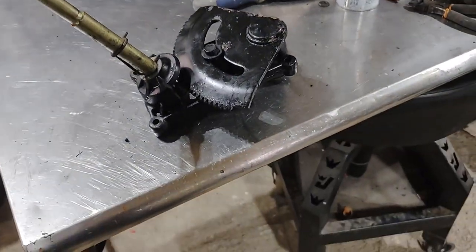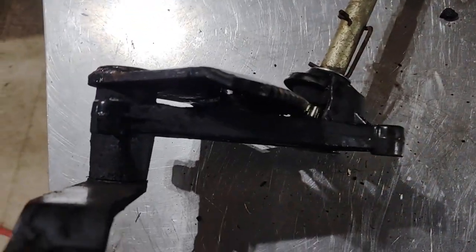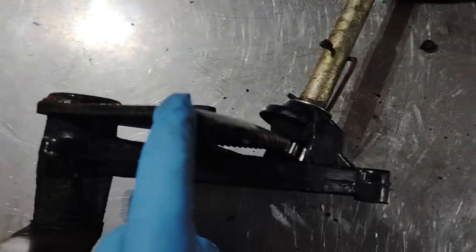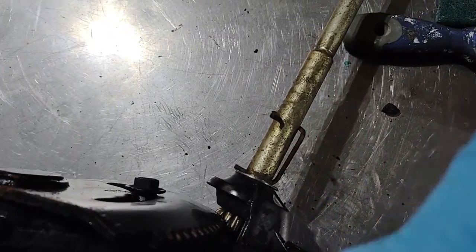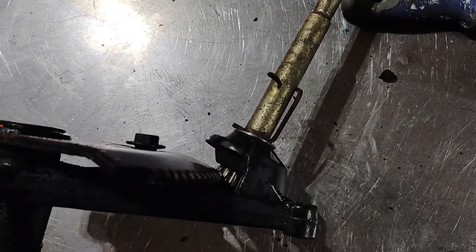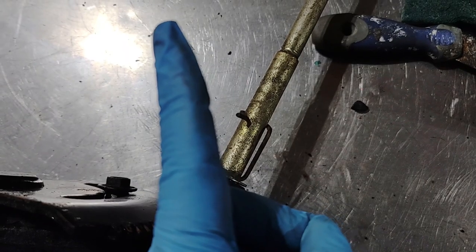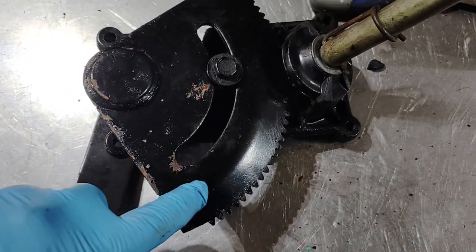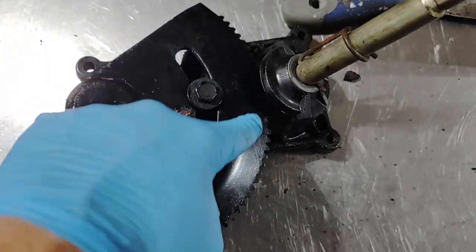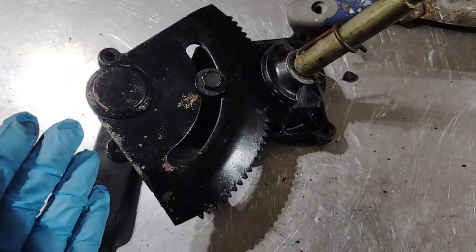So I got the steering shaft removed. From what I can see, this has got a little bit of a bevel. It's tilted down, is what I'm basically trying to say. And this is angled back. We want that to be angled in the other direction. Maybe about the same amount of degrees. So my thought is, cut it. Either plasma or whiz wheel, try and keep along that radius edge, flip it upside down, weld it back on. That'll give us the teeth in the up position.